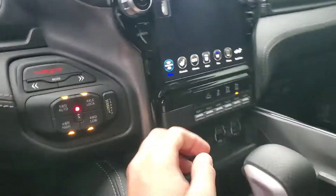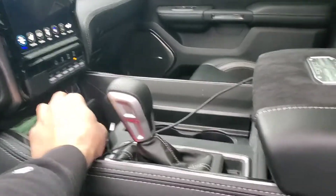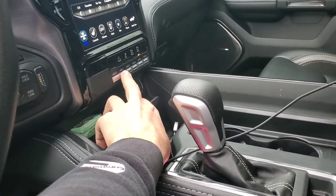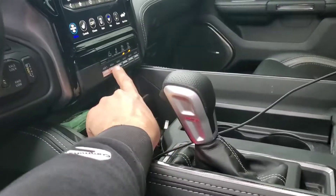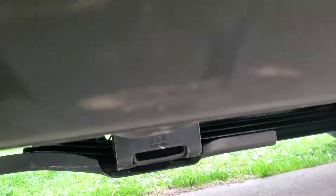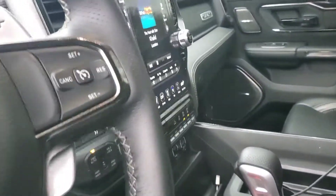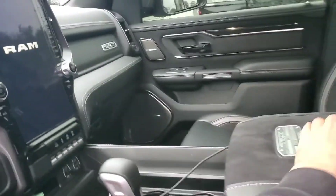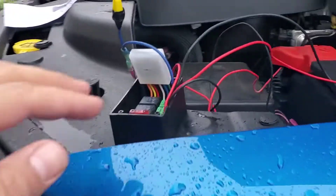Here are my keys — let me turn on the ignition. Once I hit switch number two, I have it set for four seconds, so for four seconds it will open the cutouts. Hopefully you could hear that. And when I hit it again, it also closes for four seconds. It's pretty sweet — it's the same behavior I had with the old two-relay-and-timer setup.